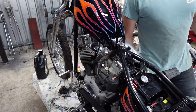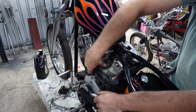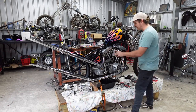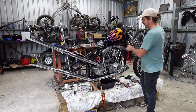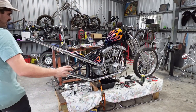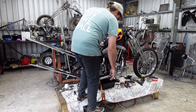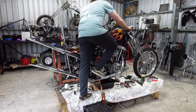I'll get some spray and we'll fucking spray it in there, I reckon. So we'll put this back. And I'll come around the other side again. We'll put some spray on it, I reckon. Put the air cleaner off, because best way to tell if the fucking carby's got fuel, this being a Super E, it's got an accelerator pumper. So you can look down the hole and you'll see a little fucking squirt of fuel when you squirt the accelerator. So it wasn't doing it before. I gave it like 20 squirts and now has fuel, so I reckon we got fuel and spark, so this thing should go. We'll do the old two-kick grind again though, and if you haven't started these things in a while, a pan underneath there will save you a lot of cleaning up.